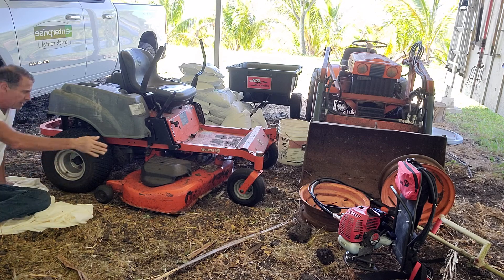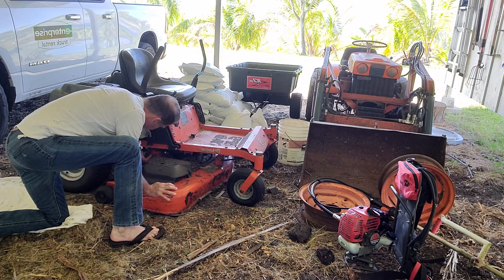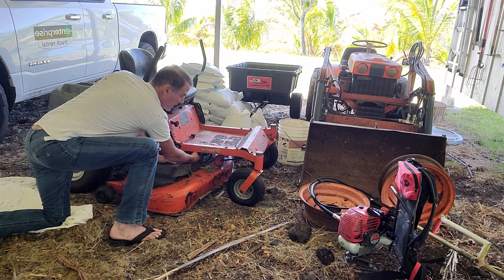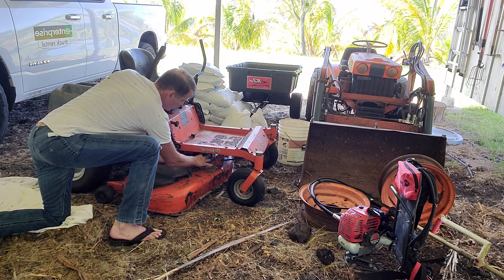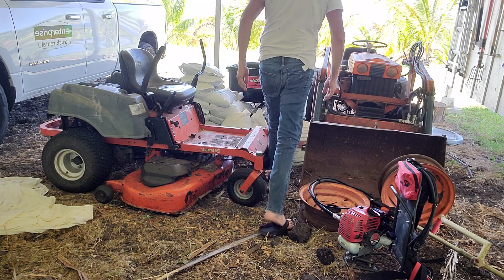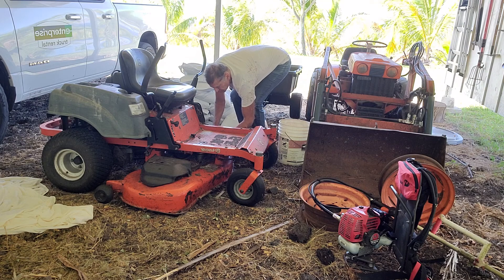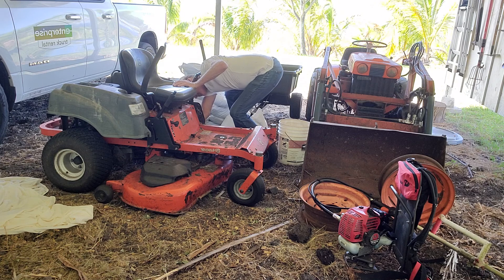Start from the back to the front. There's a little ear right here - pull out the keeper and the washer. There's a keeper and a washer right behind. There's two little tabs right here, and on the back side there's an arm. There's a keeper and a washer back there too. Cotter pin and washer - same on the other side. Cotter pin and washer behind the little arm, and on that little ear tab in the back of the deck. You'll see it.